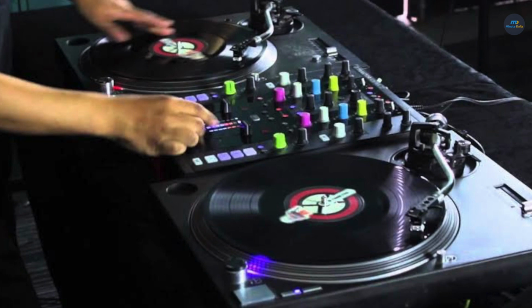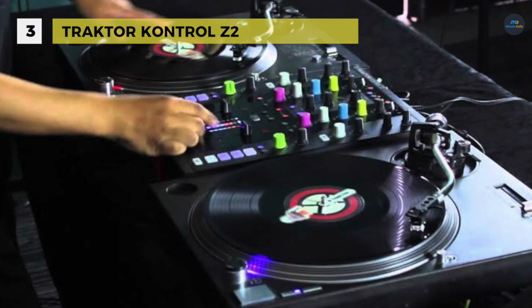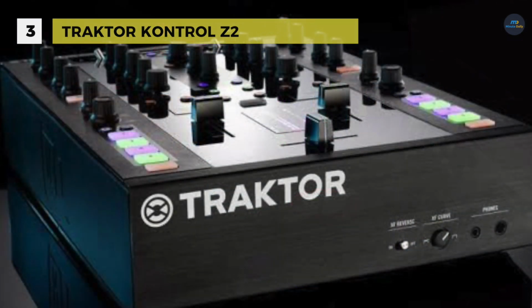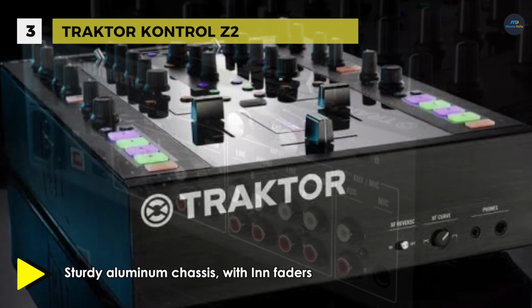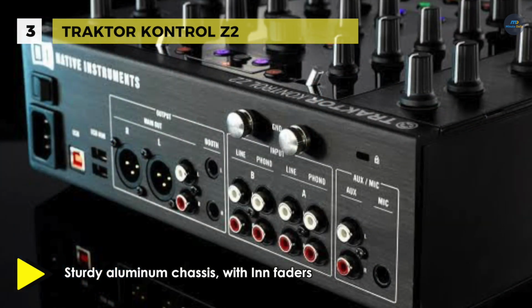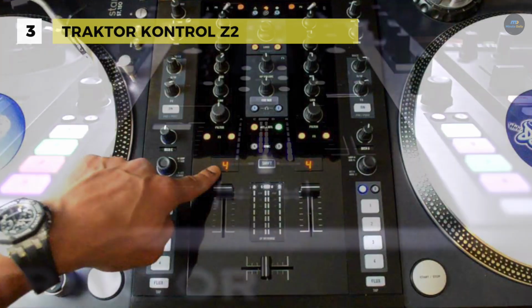The Traktor Kontrol Z2 from Native Instruments is a control mixer that features 2 stereo input channels and 2 stereo output channels. But its plentiful connectivity offers far beyond that. It is ergonomic and spacious, with a level fader, 3-band EQ section, and chunky filter knob per channel. The 24-bit sound card features Cirrus Logic converters and XLR outputs that provide low-noise audio.